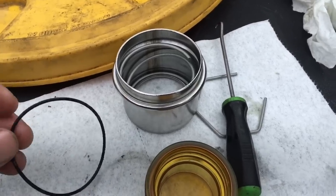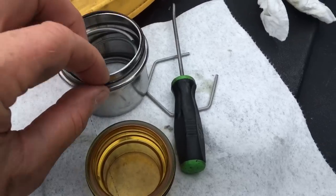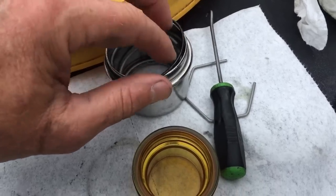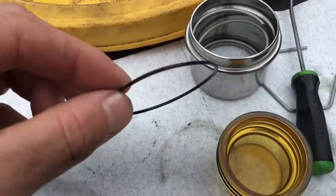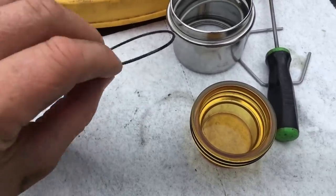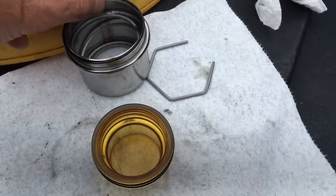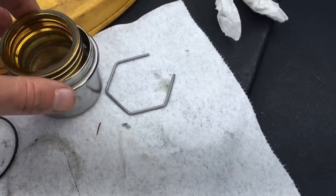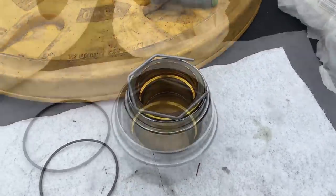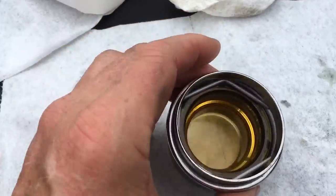This is a simple little o-ring here — I'll put a little sealant around the outside of that too, like a gasket maker, just to enhance it. I tried to find replacements but wasn't sure where to get them — this is off a 2004 trailer anyway. I'm going to put this back together. Just before you tap this back in, this goes in here, and then this ring goes inside to hold it in place. I'll show you how it works in just a moment.